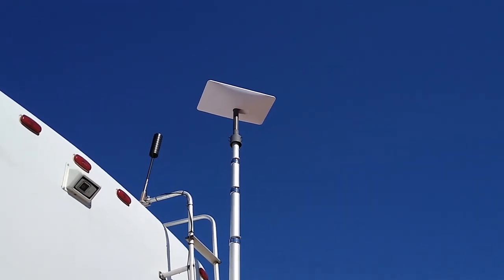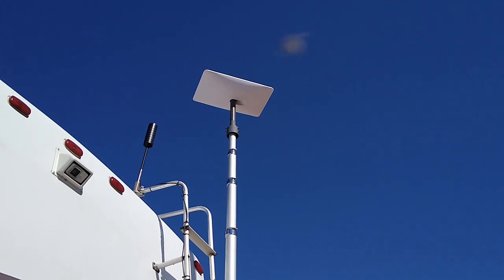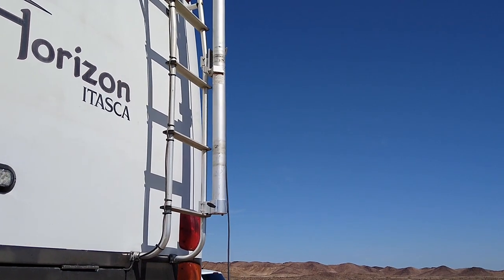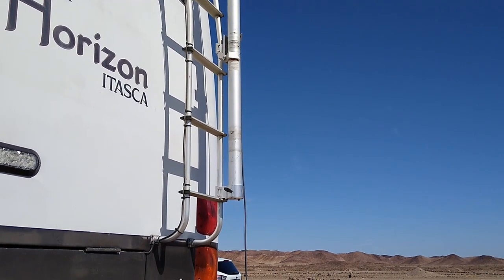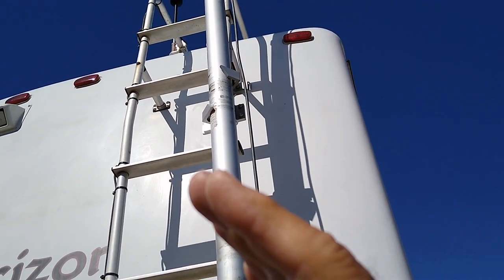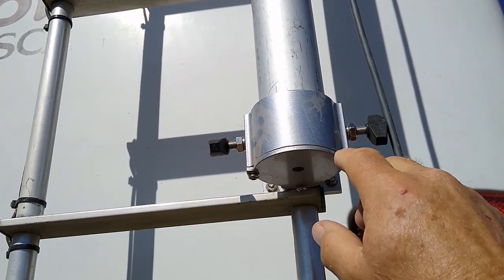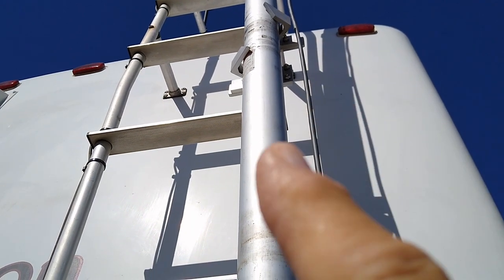We're back. As you can see, we've got the dish mounted on top of the pole. The system is just turned on so the dish is currently searching for satellites. Here's how we've got it fixed to the ladder on the back of the rig. This is an aluminum flagpole mount that I picked up online from Amazon — I'll put a link in the description. What you do is take the pole and put it in at an angle, then tilt it up vertical and drop it down into this pocket right here, and then you have these two thumb screws that you tighten down and then a couple of lock nuts to make sure the thumb screws do not come loose.